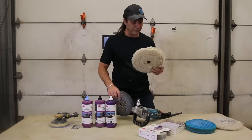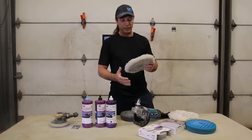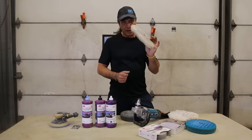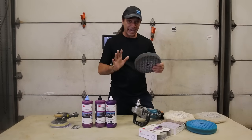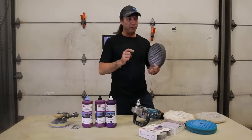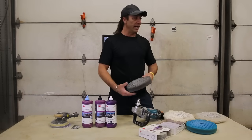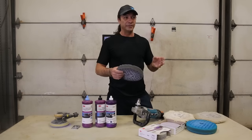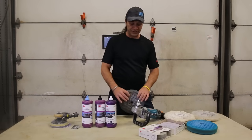Today we're going to be using the compound pad. Typically I would go to the number 2 pad, which is the polishing pad, but I'm going to teach you guys how to do away with this and just go straight from compound to the foam pad. This is with this paint, just painted an hour ago, baked at 140 degrees for about 20 minutes. It does stay relatively nice and soft. If you want to be more precise, go with the number 2 pad, but this is more for production.